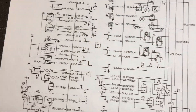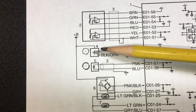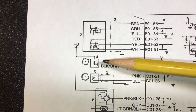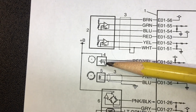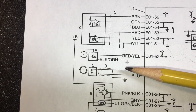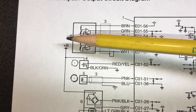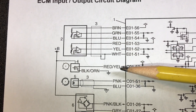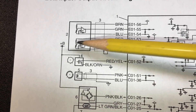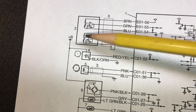Let's confirm what we found against the wiring diagram. Item four on the diagram is the cam sensor - item five is actually the crank sensor, a two wire VRS crank sensor, but we're concerned with item four. You can see that the black and orange wire, which we thought was the ground, is in fact the ground. The other wire goes to battery positive - we confirmed that to be the black and red wire - and we have a red and yellow wire confirmed to be the signal wire.